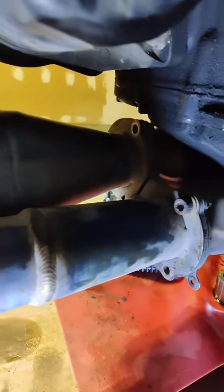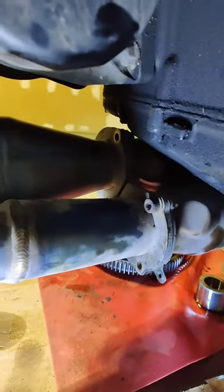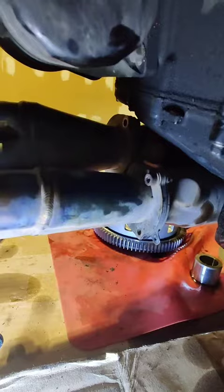I just stripped out the last allen head bolt that I need to get this exhaust off so I can drop the oil pan, so I can remove the circlip to pull out the shift mechanism to get to this shift star. I've got this bolt here and it's stripped out, all rusted, and I can't get the thing off.